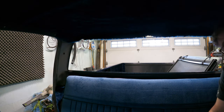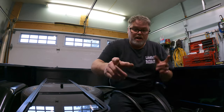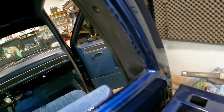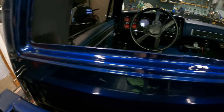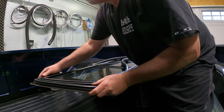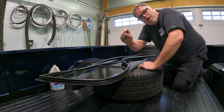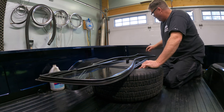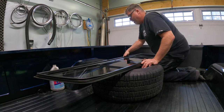Let's clean this rubber off and come back. So now that you have your rubber all cleaned up and nice and ready to go, you want to take that slider and face it towards you on the inside — you want the inside facing you. One other thing too: make sure you put a coat of wax underneath where the rubber goes, to keep her looking as mint as this truck is. So we're going to put the rubber on the glass now. You want the hook to face in towards the truck. Now I bought this slider — it's a factory replacement slider. Some sliders you gotta watch what kind of rubber you have. If you have a big thick rubber you need a different kind of slider. Hopefully you have the right rubber for the job. It's always good to have the right rubber for the job.